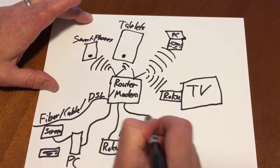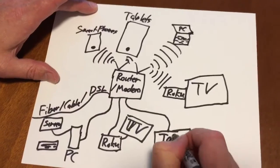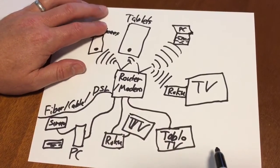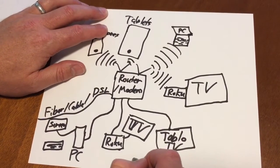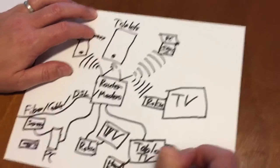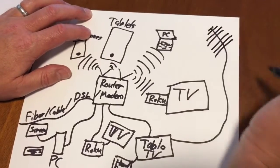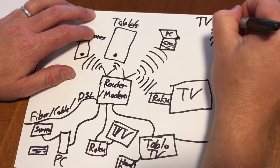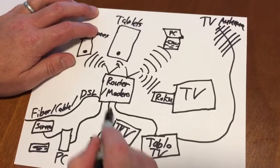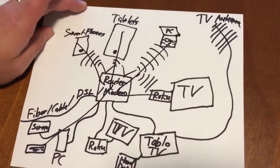What you do with the Tablo TV — the best thing is to hardwire connect it. This is how we have ours: it's a separate little device that connects via Ethernet into your router. You plug in a hard drive to store your TV recordings, and then from the Tablo you connect a TV antenna. The TV signal comes into the Tablo, the Tablo records it onto the hard drive, and then it's on the network so you can watch TV on any of your devices.